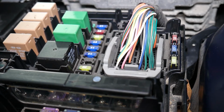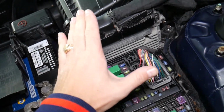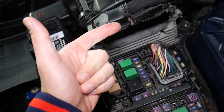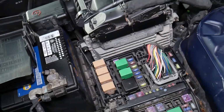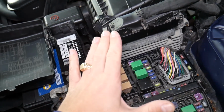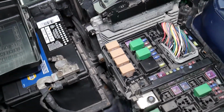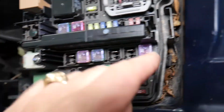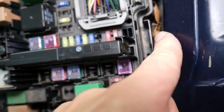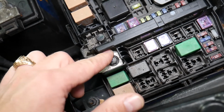If for some reason you don't know how to know for sure if it's burnt, what I recommend is to disconnect the car battery. Now that's where things really matter. If you don't disconnect and reconnect the car battery in the correct order, you can burn the engine computer, electronics, modules, and that can cost you a lot of money. We made that mistake and it cost us $2,000. So we have a video that explains how to do that properly, and I'll put the link in the description of the video below. Once you do that, disconnect that nut right here, that cable. You have one tooth holding that mega fuse right here. Pull it to the side, pull the fuse out, and test it with a voltmeter, just like checking a fuse. One lead here, the other lead on that fuse, and see if you have a continuous connection.